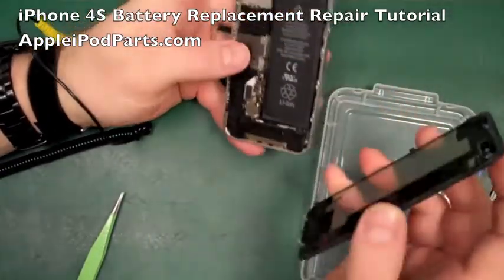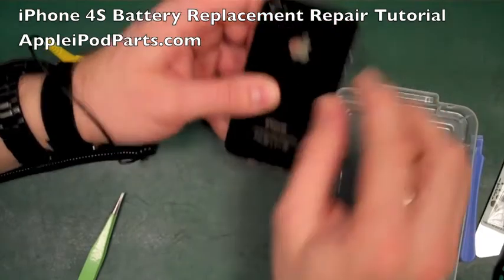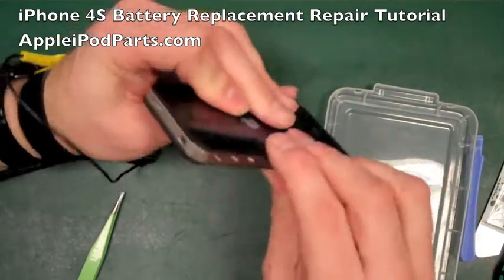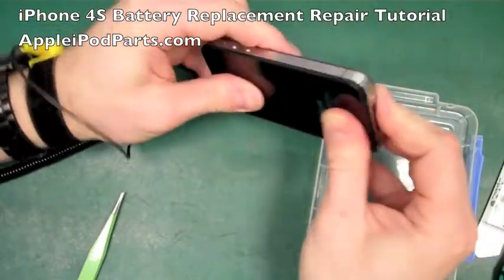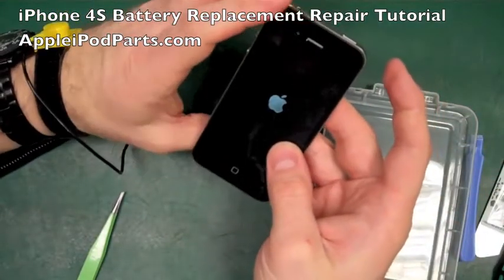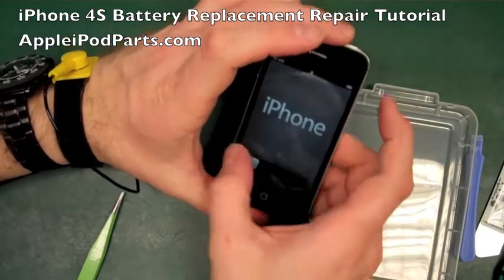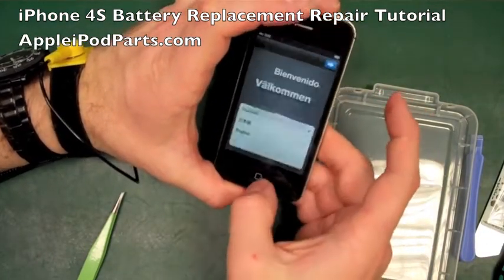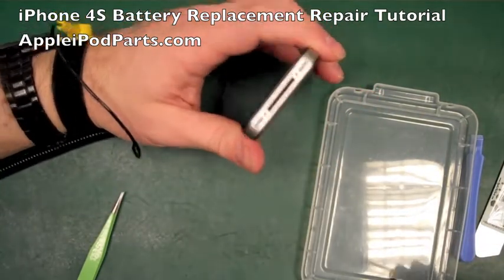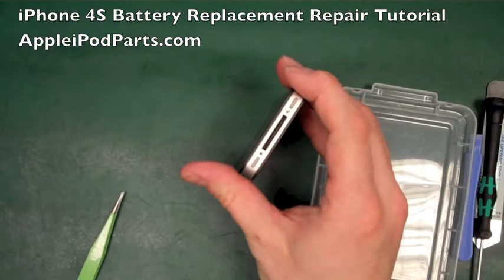The last thing we do is check for dust in the camera lens - give a blow out on both sides. For the rear camera, you can see it's half the camera hole - that's your guide. Half the camera visible, push the case down so it's flush, then with your thumbs and fingers slide it down to the bottom. There we go - one camera, one screen - the iPhone 4S powered up and reassembled.